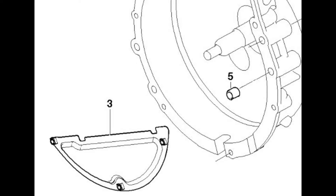A couple of points I didn't cover in this video: before you take off the sump you need to remove the plate off the bell housing — it's the one labeled number three — and also you need to disconnect the oil level sensor from the bottom of the sump, which is a pretty obvious one, but the plate is the less obvious issue.